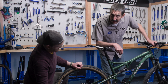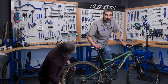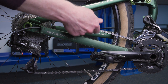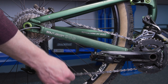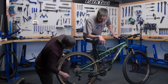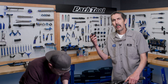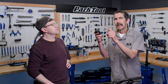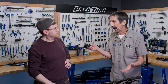Now we're going to simulate riding. Walk the front brake and push on the pedals. Now let's check again — check the top: tight, yeah. Check the lower section: still stress free. The stress of riding is between the top of the rear sprockets and the top of the front sprockets. The guide pulley is shoving the relaxed section of chain from sprocket to sprocket — that's how we're even able to shift the gears.